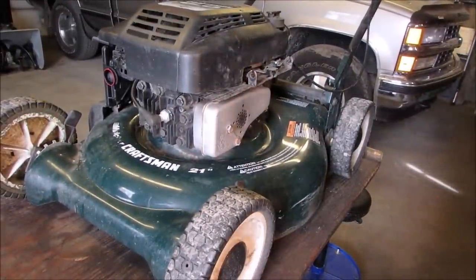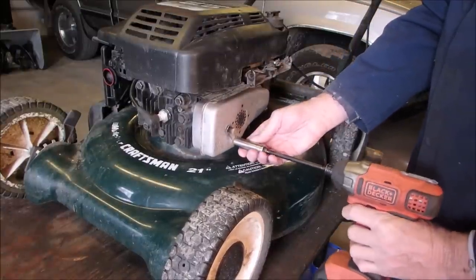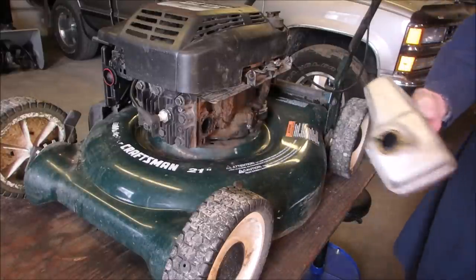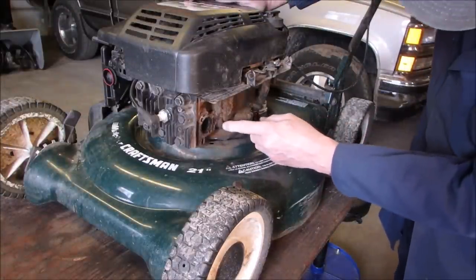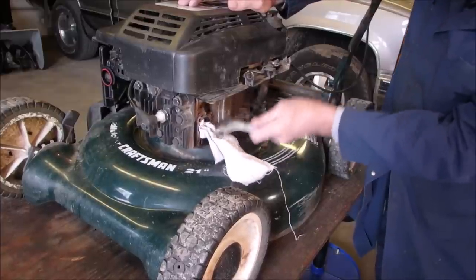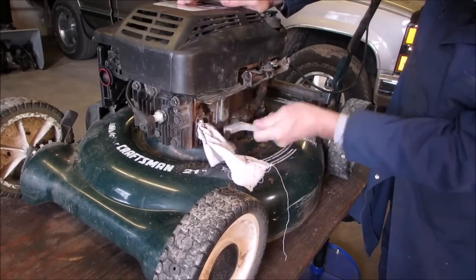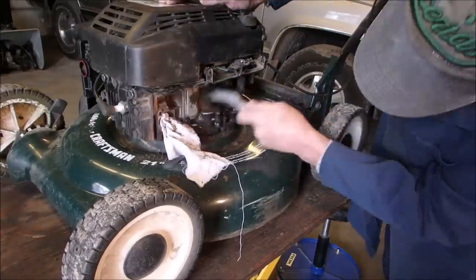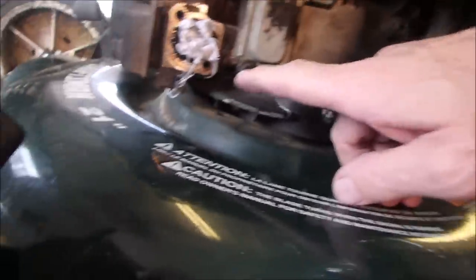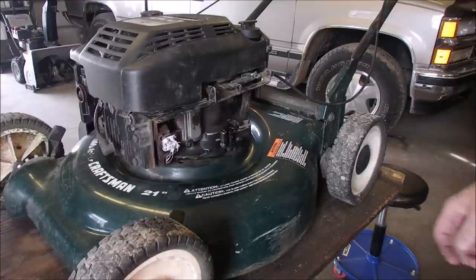Let's just start poking away here. There's the exhaust port. Now let's just get a small brush — plastic maybe. We have to get to the valve door. There are two bolts — one there and one right up in there. We're going to take those off once we get the cylinder to top dead center on the compression stroke. So let's get that little door off.